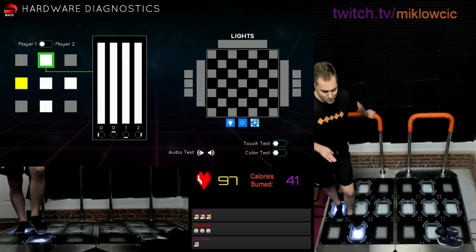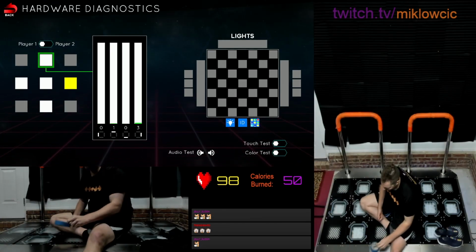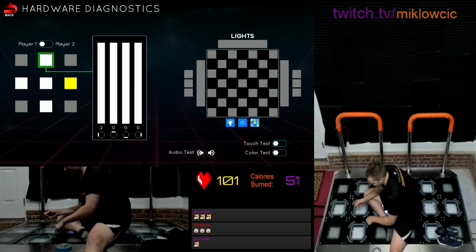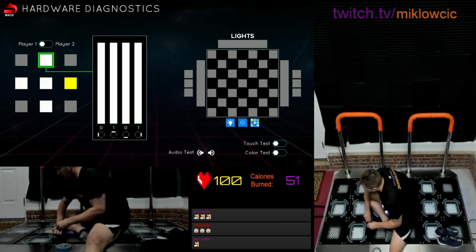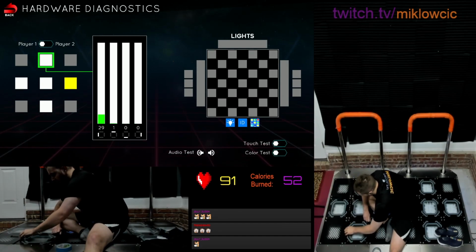Once you've diagnosed the oversensitivity or undersensitivity issue in a certain panel, you can remove that acrylic panel, but make sure you take the orientation of the panel into consideration. Do not rotate your panel when you put it back on because panels can come slightly bent and this will change the pressure on different sensors.